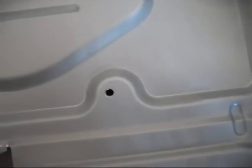Something special on this case — there's actually an indication on the motherboard tray. You can see Micro ATX labelled with holes A through I, and ATX labelled with holes A through L. There are letters at each of the holes to determine which holes to put the risers in. I have a Micro ATX motherboard, so I've already put all my risers onto the correct holes, and now I'm starting my new build.